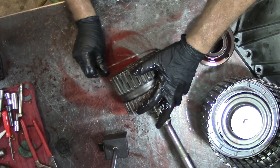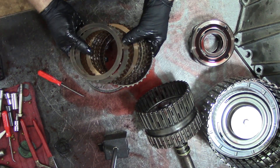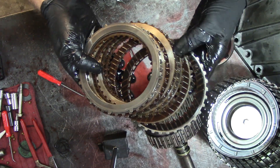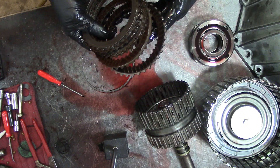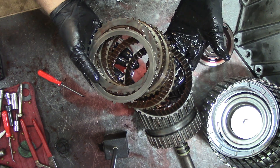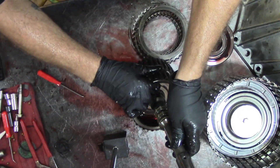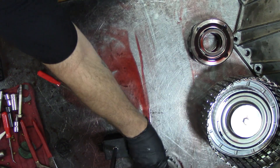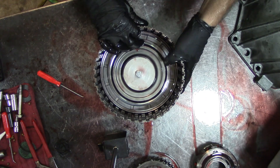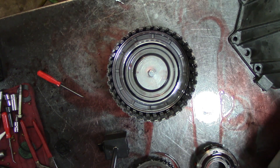The 4-5-6 are burned as well. So you're slipping in third — 3.5 reverse. You shift into fourth gear and this drum right here is your shudder, this is what you feel. This drum is no good and needs to be replaced. That's the diagnosis.